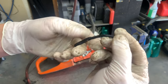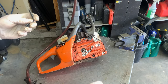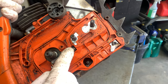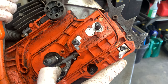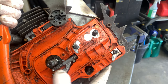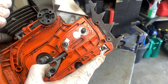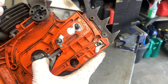Here's the piece that runs from the oiler up to the bar. It's still pretty pliable, looks like it should work, and it's not clogged. You can manually test these — this is where the oil is going to come out. If you spin it with your finger, you can actually see oil starting to bubble out. So that tells me it's picking it up from the tank, which is right behind there, and the pump is actually working correctly. Of course you can't really spin it fast enough to make it really do much, but as long as it's pulling.